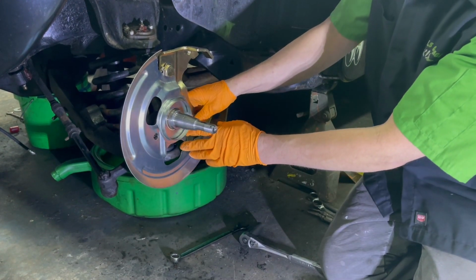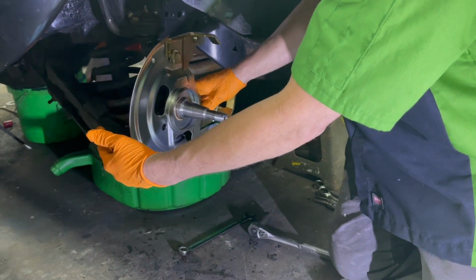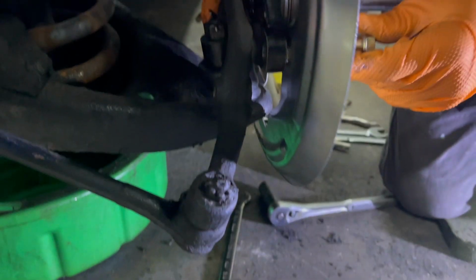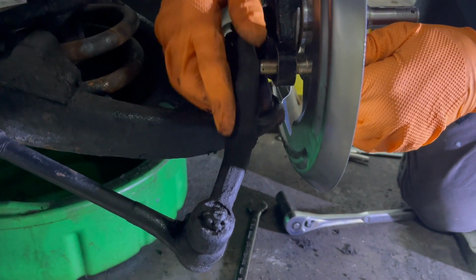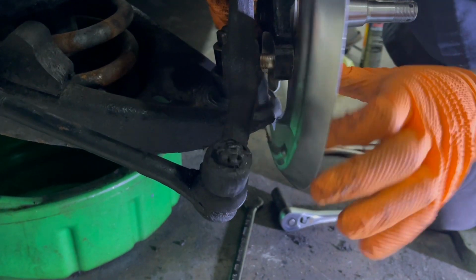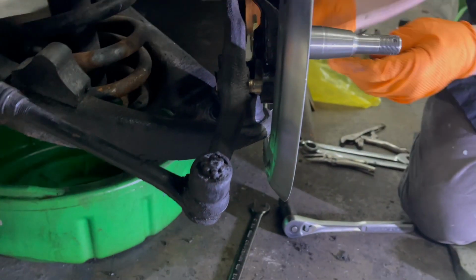See the dust shield's lining up well with the spindle and the holes in that. We'll then take this steering tie rod and stabilizer bar that's on the back side of the spindle and the dust shield and thread or bolt through all three pieces. We'll work on lining that up. We'll do that with the other one.